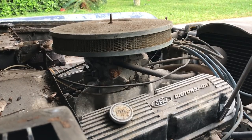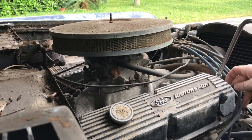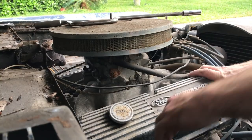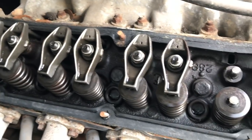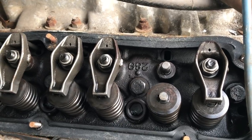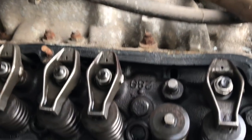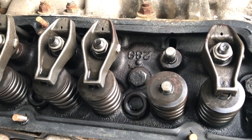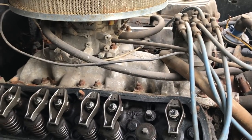I have a good feeling about this engine. I think it's going to run pretty easily once we sort out some of this crazy stuff going on. I don't think it has many miles on the engine itself — I think he put it together and then broke the stud and just parked it. So I have faith in this engine. Here's the culprit right there — one broken rocker arm stud, and the rocker and push rod have been removed. He told me they pulled them out to avoid any more damage, but the rest doesn't look terrible.